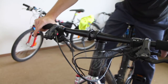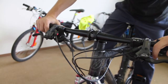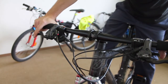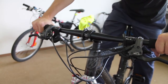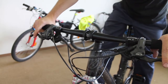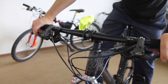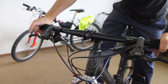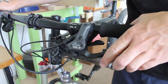I'm going to bring these in about half an inch, which will force the shifters in the same amount. As for the shifter position, I think they're fine as-is. A lot of it is personal preference, but generally you want as much area to grip the bar as possible while still having good leverage on the brakes. As it is now, if I grip where I want to, I'm not at the end of the lever, so I lose leverage — that's why I need to bring these inboard about half an inch on each side.